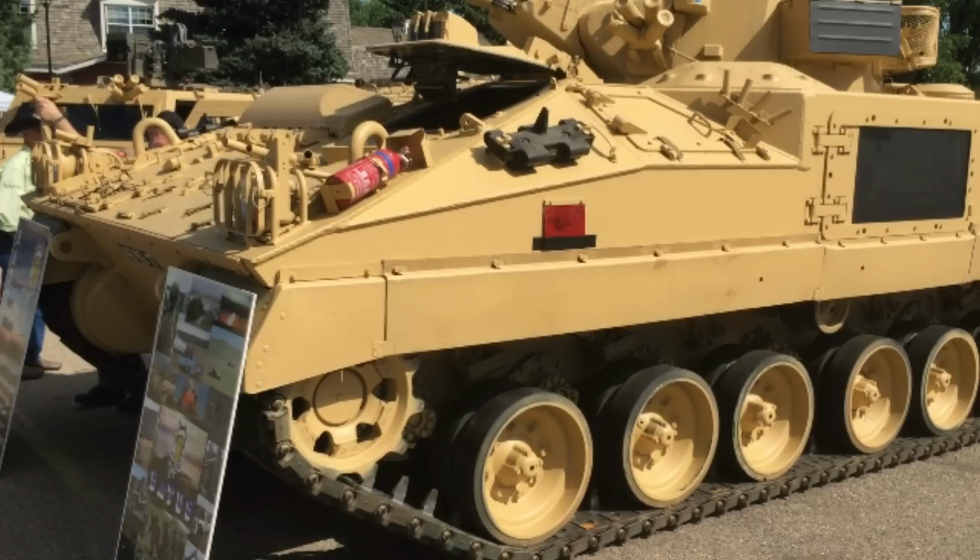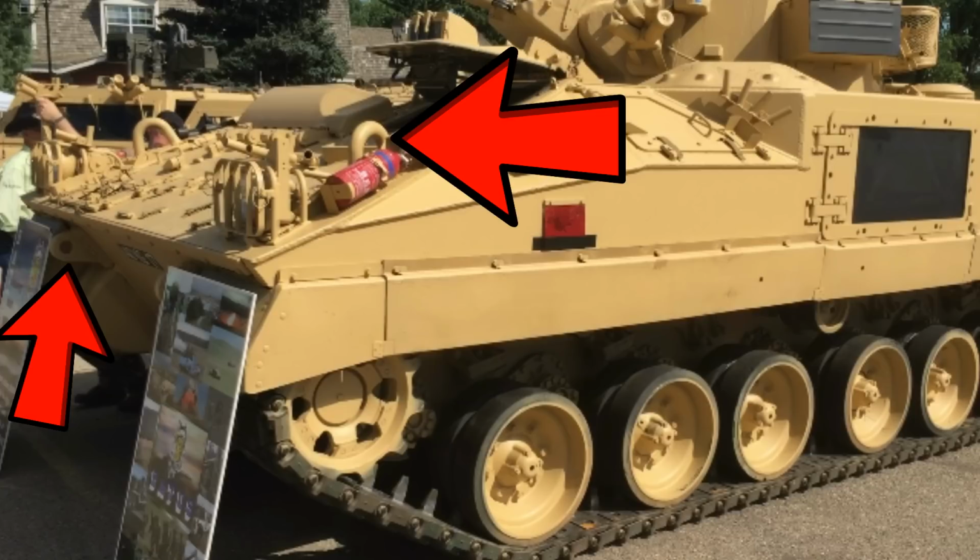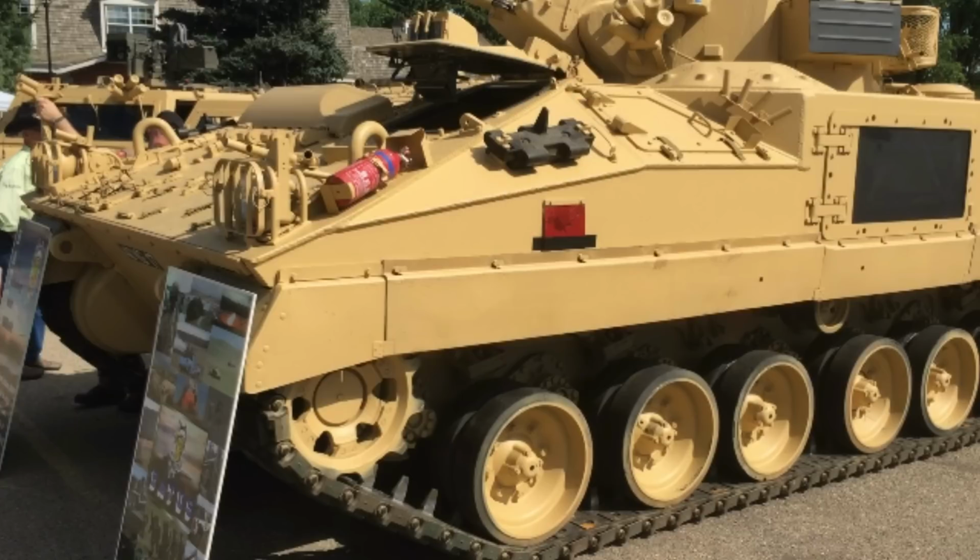The vehicle does have two very large lifting shackles, both at the front and at the very top front of the vehicle. Now, this vehicle is not able to be airlifted, it is far too heavy, but these shackles help a lot when trying to recover the vehicle quickly. We can get a crane on the front, hook it up to those two towing pintles, lift her up nice and high and get access to the underside of the belly and such. They are big, heavy-duty shackles too, so they're really handy to have.